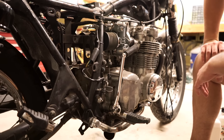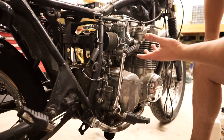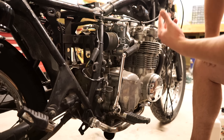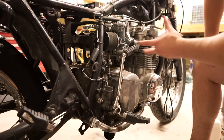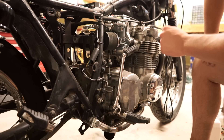I'm going to come back out here tomorrow and look at the carbs. I'm not sure what I'm going to have to do to them - I may not have to do anything. The bike's been sitting a good while; the guy said it was earlier this year or maybe late last year the last time it ran, so I don't know how gummed up everything is. Worst case I can pull them all off, pull the bowls off, spray them out with carb cleaner. It may be worth doing that anyway so I can check what main jets are in there.